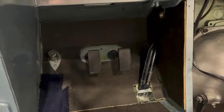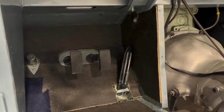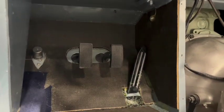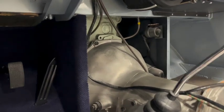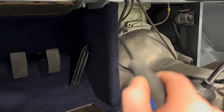There's insulation all the way around there. The next piece to go in is this jute, then generally the sills — sills are the first piece of carpet to go in on any Healey. Once the sills are installed over the insulation, you can start putting in the rest of the carpet. These carpet pieces will go in next, coming up to that top edge, and the finished product will have the black-coated jute exposed there — that's how they were finished. I've just glued in the toe board carpet. That is how that carpet goes in, and it went in really nicely. There's a little bit of excess on the outside that you have to trim off even with that flange edge, and then I've got to use my trusty awl to find the three screw holes for mounting that cover panel.